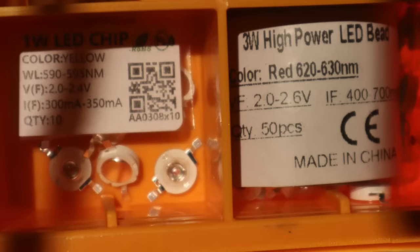A possible enhancement is that you use traffic light style indication, so yellow and red. They both have different voltages but low voltage. So red and yellow are both about 2.0 to 2.4 volt. And other colors have a higher voltage that go beyond the voltage that is practical for this 2.7 volt. That would be nice to do in the final version.